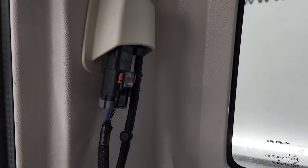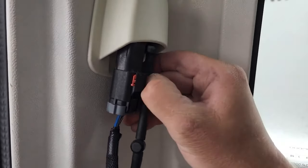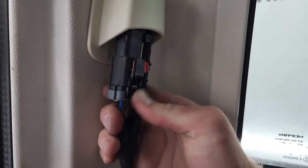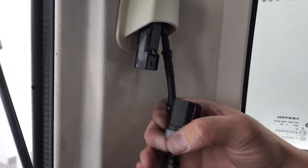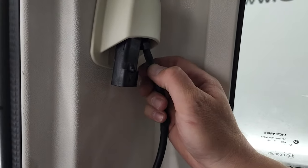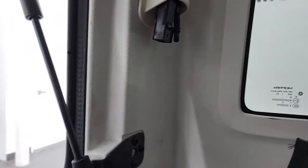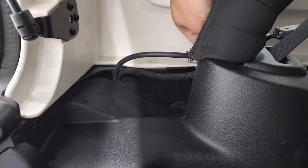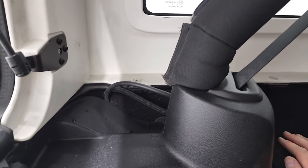This is probably the hardest part of the whole thing, and if you don't know what you're doing you're going to mess it up. There's a little safety tab here — push that to the right, and then you can do the quick release. You've got to get that safety tab over, otherwise it'll hang up. That's for the windshield washer fluid line. Now that that's disconnected, I'll show you where I usually put mine once we get the hard top off — they don't have a good spot like the JLs do, so I used to tuck it under the carpeting.